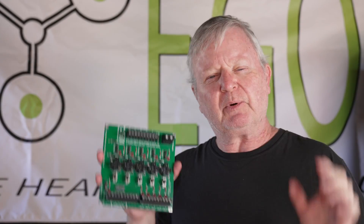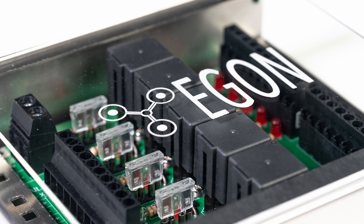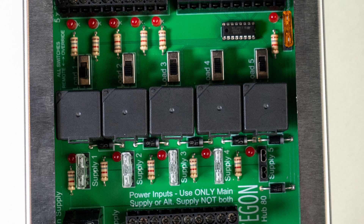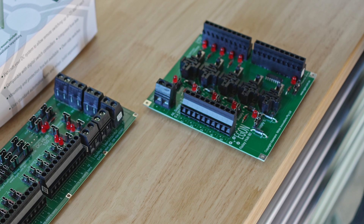The switching of these five relays — you just follow the instructions, and all the instructions are written right here. It simplifies things so much to the point where you don't have to do a lot of thinking. You can switch your driving lights, have a feed from an ignition source for things like daytime running lights, and of course you can run water pumps, water heaters, and lights of all kinds — up to 25 amps per circuit.